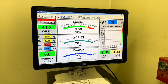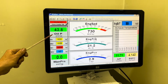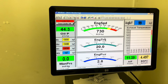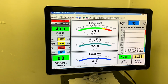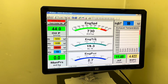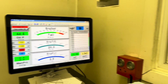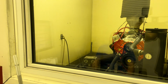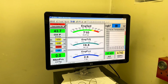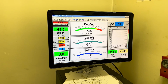Okay, we're going to make another pull now, and I want to focus on something. In the top left-hand corner, the green bar is the oil pressure, and as it revs up, it's going to increase. I had a comment on my channel. We started this engine up with 20W50 Lucas break-in oil, and we've dumped that oil and changed it, and now it's got 30 weight oil.